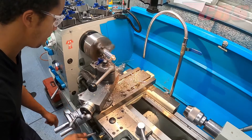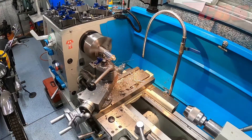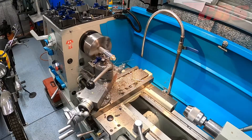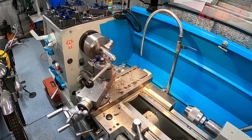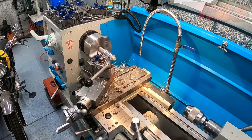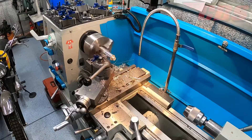We're going to start off with some 6061 round stock aluminum. The diameter is about an inch and a half and what I'm doing here is turning the OD down. This aluminum round stock was scrapped and I think I was using it for a mandrel before, so I did not have to turn and cut any threads fortunately. I'm cutting the depth properly to accept the short and long fork bushing.